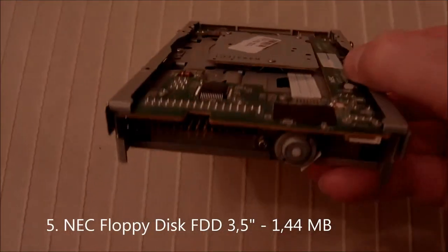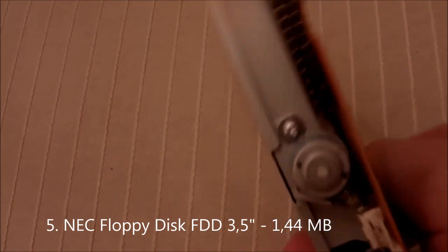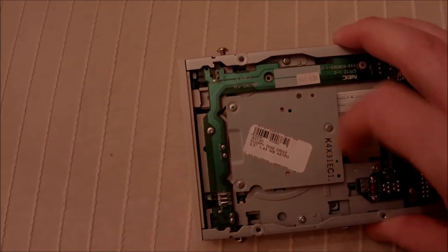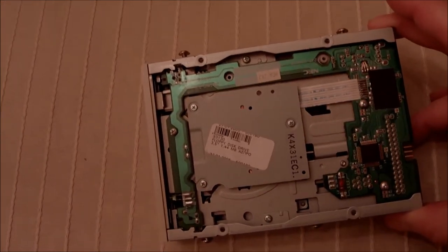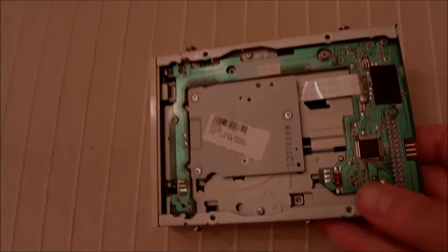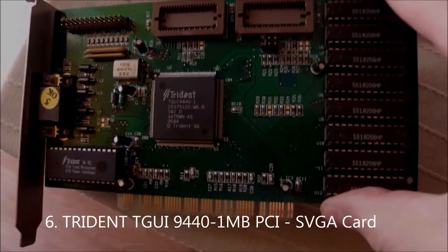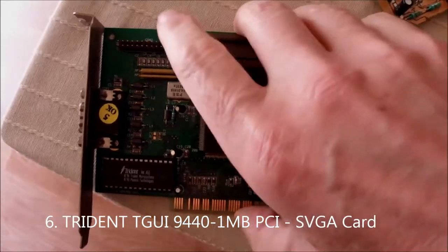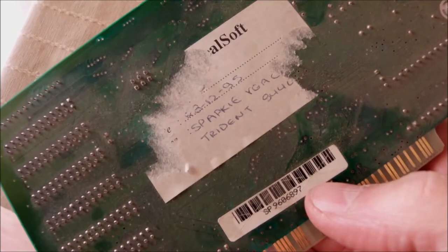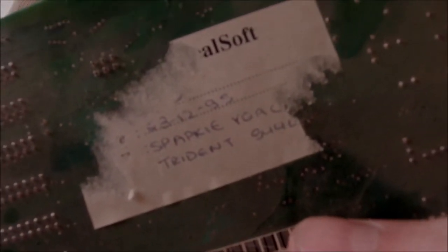Hitachi is a great manufacturer — everybody knows that. And let's move now to the well-known 1.44 megabyte floppy drive, which is going to be selected as drive A, and the other one will be drive B. This one comes from NEC Corporation — another great piece of hardware. If you haven't used yours for converting it to the Amiga 500 mod, then you can put it back in action. The video card I found is a simple Super VGA Trident 1MB PCI card from 1994, sold back in 1995. It still has all the dust and dirt on the back side. It can support an upgrade to 2MB.